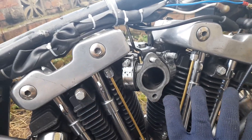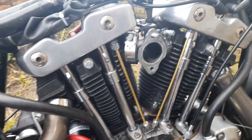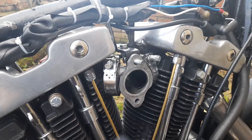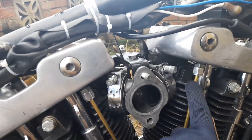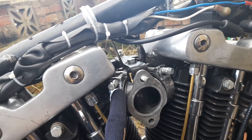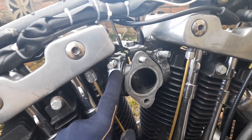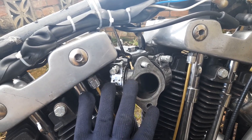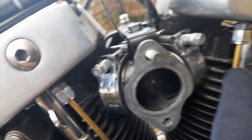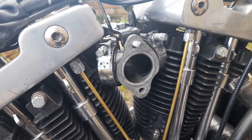The thing is, once you've done away — if you haven't got that breadbox air cleaner that bolts on — once that's gone, all you have is the inlet ports. These clips here holding the entire carburetor and air filter up. Obviously it's bouncing around a lot, it's quite heavy. And if this is all you've got holding it up, then these rubbers in here — you can just about see the black edges of them — they'll tear every few weeks. You'll be replacing them. You'll hear it go on one cylinder.